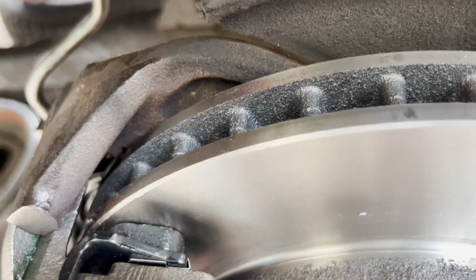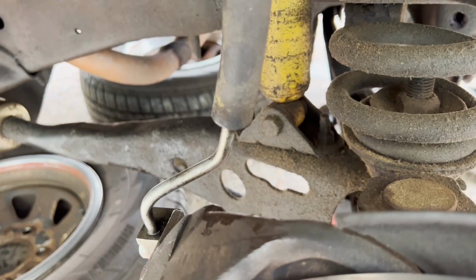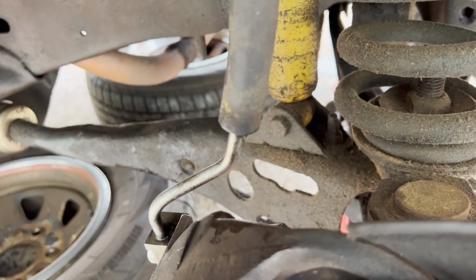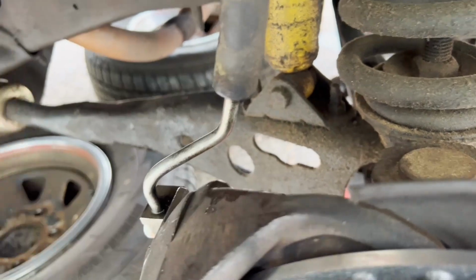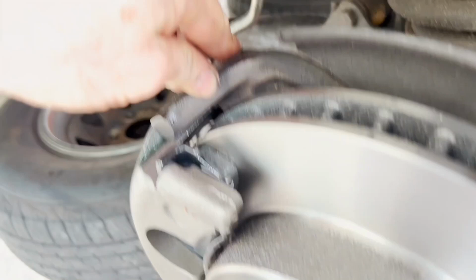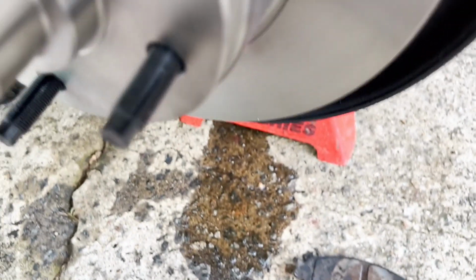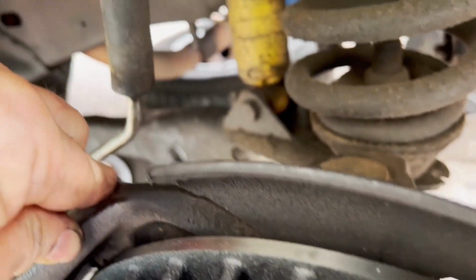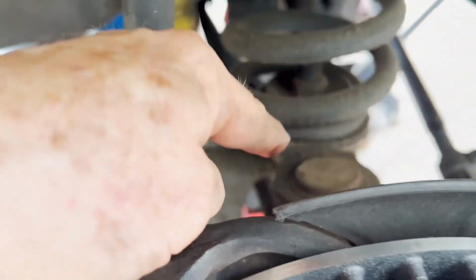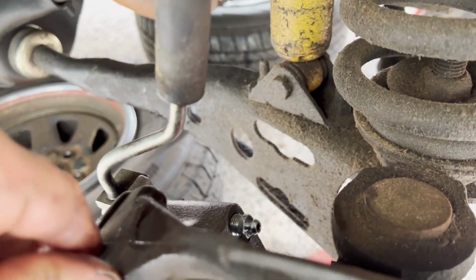And then as you go along, you will notice that the fluid just goes up. You're repeating that process of opening and closing it. But when you do that, you have to take the hose on and off every single time, and that just kind of slows you down. So if you're in a setting where you don't have to worry too much about this stuff getting on the pavement, do that. Keep in mind that once this thing starts building pressure, it's going to shoot pretty far, and brake fluid does destroy any painted surface it gets on. So just keep that in mind.